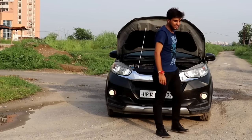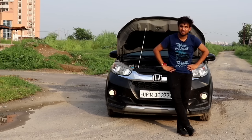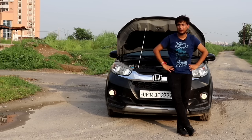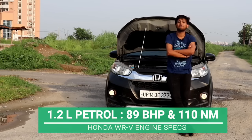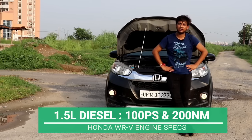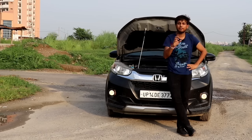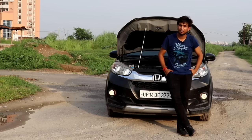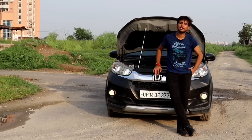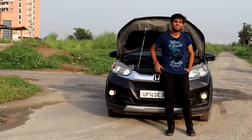Talking about the powerplant — it comes in two engine options: petrol and diesel. There is a 1.2-litre petrol engine and a 1.5-litre diesel engine — both tried and tested in the Honda Jazz and Honda Amaze. Even the City shares the same diesel engine. The 1.2-litre petrol produces 89PS of power and 110Nm of torque. The diesel variant produces 100PS of power and 200Nm of torque. The mileage difference is significant — the claimed petrol mileage is around 17.5 kmpl, with real-world figures around 12-13 kmpl. The diesel is very efficient with a claimed 25.5 kmpl, and in real-world use you can expect around 18-19 kmpl. The engine specifications feel cool, so let's see what the driving experience says.